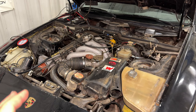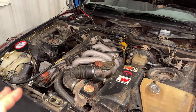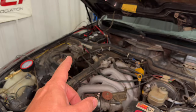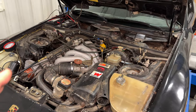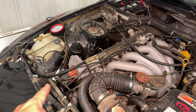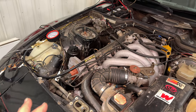This car does not use OBD2 — it is way too old for that — so I have some manual diagnostic tools hooked up. I have a fuel pressure gauge over there and I'll put a camera facing at that. I do have a voltmeter over there just to make sure that the voltages are okay. We are getting AFR on the dyno, and I also have the lead for the ignition hooked up from the coil, so we'll be able to monitor the spark coming out of the coil.